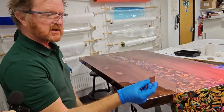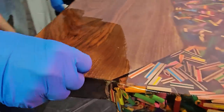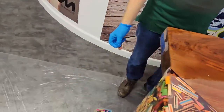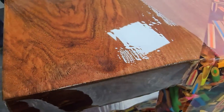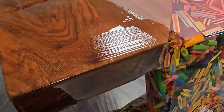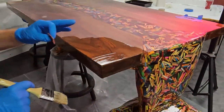If you get a fisheye, the easiest way to deal with it is a tiny bit of clean 120-grit paper. Just sand that area — you're effectively sanding the epoxy into the contamination. If you brush it again, you'll see that it disappears. That's another top tip — it's not ideal, but it's a get-out-of-jail-without-a-lot-of-grief tip. I would not have thought of that. You can see it occurring here as well. If you do the same again there with clean grit paper and just brush over it, you can see it's completely disappeared.